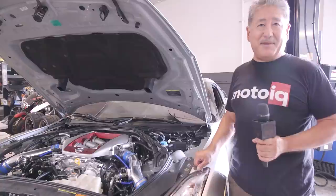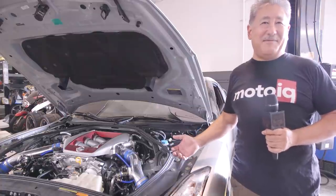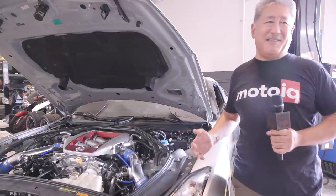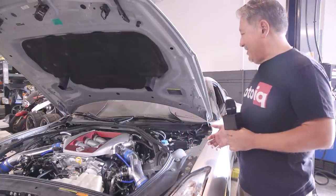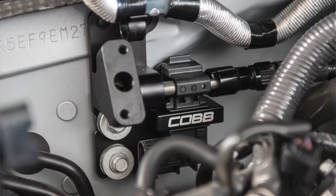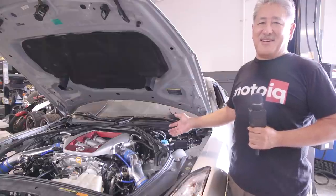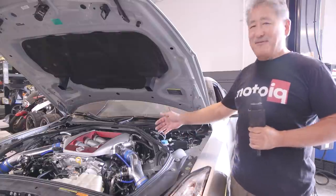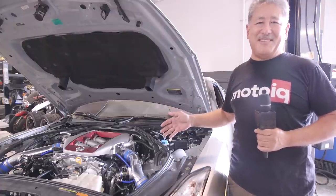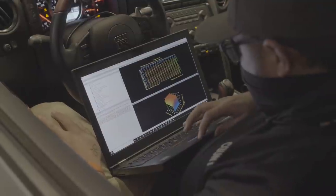One of the things that's going to give us a lot of power and reliability is the ability to run ethanol as a fuel. We plan to run pump E85, which adds a lot of safety margin. E85 has way higher octane than pump gas and also runs a lot cooler. To accommodate that, we have a flex fuel sensor behind the fuel rail and a fuel pressure sensor. You can use the Accessport to take data from the ethanol content sensor and fuel pressure sensor to make on-the-fly adjustments to fuel and spark maps. The fuel pressure sensor also adds a safety layer — if fuel pressure starts dropping off, the ECU can be programmed to revert to lower boost pressure to save the motor.